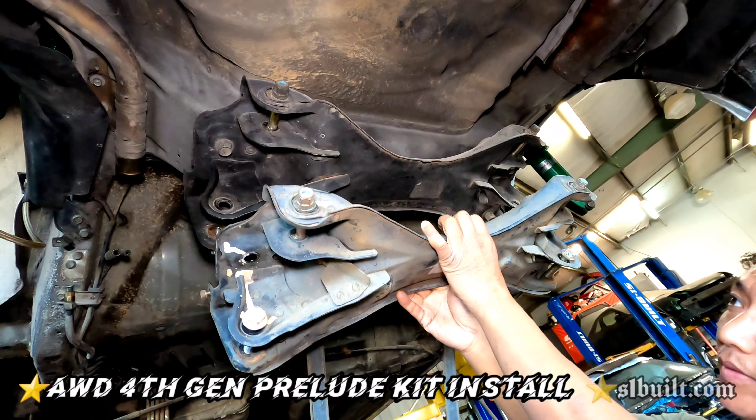It works but the angles aren't really where we'd like them to be, so we need to twist this a tiny bit. We're going to come out with our own modified e-brake bracket. You can see I have the factory piece bolted up here and I route it like our other all-wheel drive kits. Everything works fine as is, it's just not the prettiest. Want to see full camber? Oh damn — yeah, that's full camber, maxed out on the kit. They can go full stance and raise it back out and drive home.